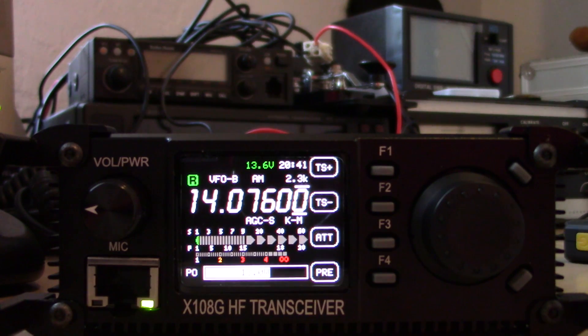Among fixing a couple other little bugs, we're going to go ahead and do this. I have not done it yet so we're going to do it together. Before we do anything, you need to make sure you get in a Yahoo group or a Facebook group and find the appropriate firmware for your unit — you will damage it otherwise. There's an outdoor version and an indoor version based on the serial number. If the serial number starts with zero you'll get one kind; if it starts with a one like mine, you'll get another. Make sure you get the right firmware.